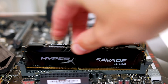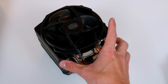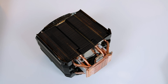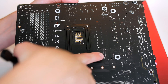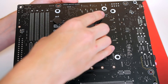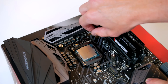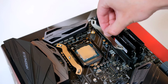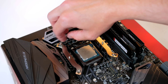Now let's prepare the CPU cooler. It's quite a big cooler and there are a few steps, but it isn't too hard. First, remove both fans from the cooler by pressing the latches inward to release and sliding the fan upwards. Take the Intel bracket and install it from the rear of the motherboard by pushing the four legs through the holes. Then get the four standoffs and screw them into the pegs you just fed through. Next, take the two Intel brackets, sit them on top of the standoffs, and attach them using the four thumb screws.